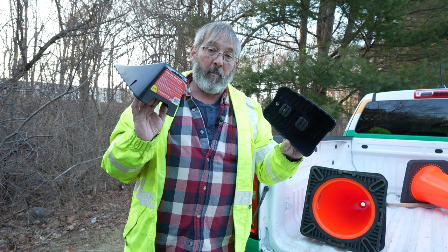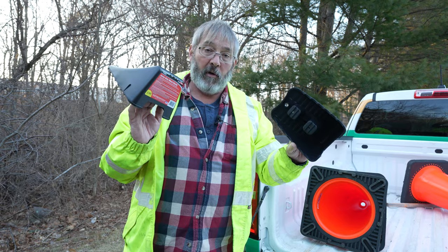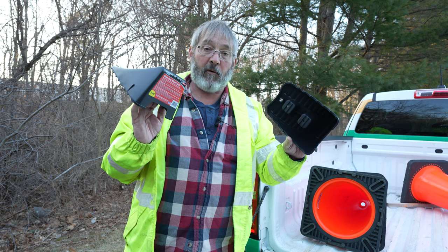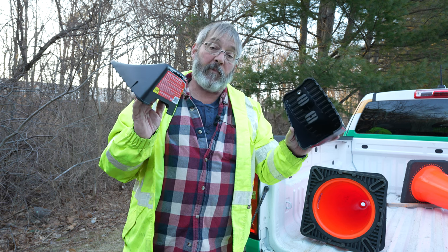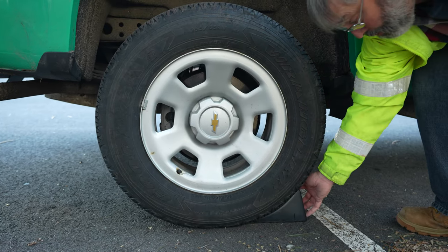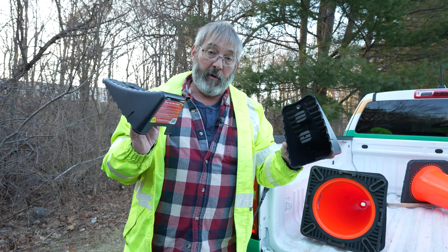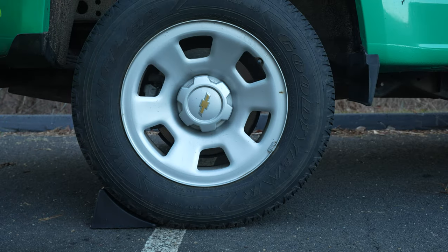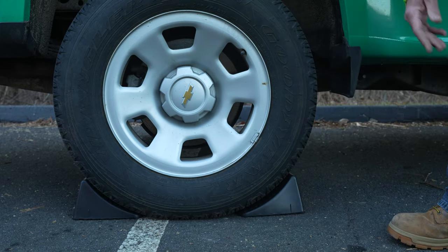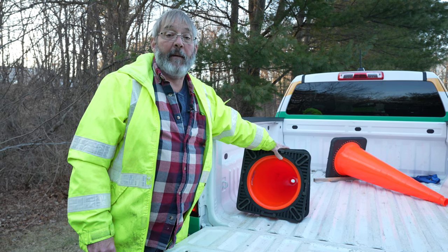Because we are on incline parking uphill, you would place one chock on each back wheel to ensure the vehicle does not roll backwards. If you are on an incline going downhill, place your blocks and chocks on the rear wheels on the downward side of the tires so that the vehicle does not go forward. If you are on a flat, put both chocks on the same tire — one in the front and one in the back of one of the rear wheels. Now you're ready to place your safety cones to make sure people know you are parked where they may not be aware of you.